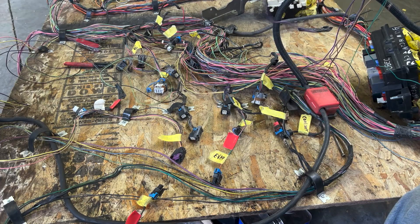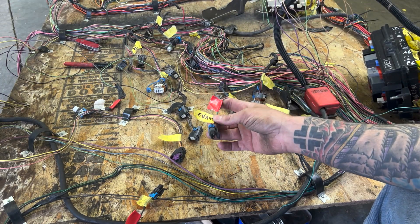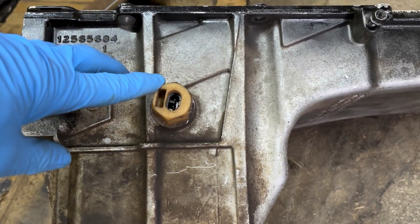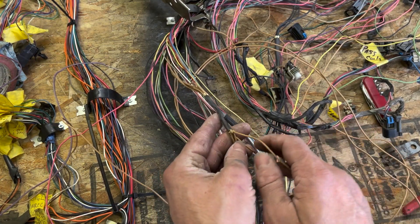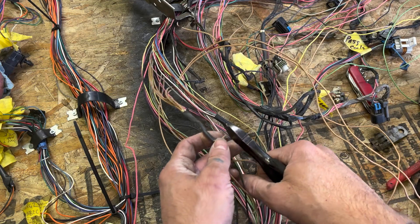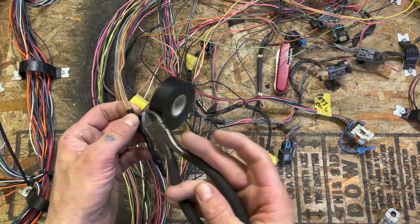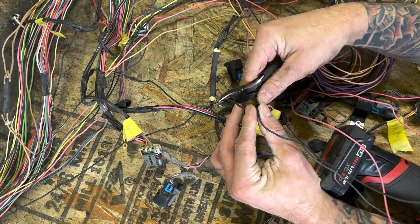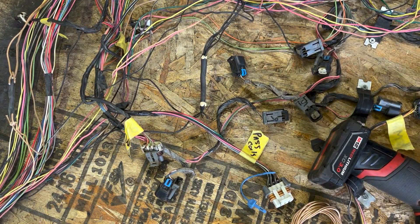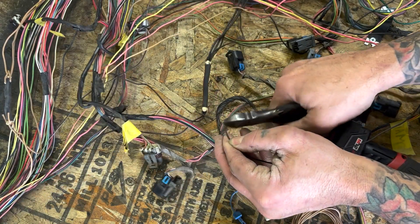Now we can pull all the wires removed from the PCM. I also marked other wires to remove with red duct tape — here's the wiring for the EVAP sensor, this one is for the oil level sensor on the oil pan, and this is the coolant reservoir sensor. I'm only running the front two O2 sensors for each bank, but all these tan wires go to this splice, so I'll snip those off for now and tape them. The black wires for the O2 sensors also go to a separate splice, so again I'll snip off the ones I'm removing. The black wire on the coolant reservoir sensor also goes to that same black splice pack.